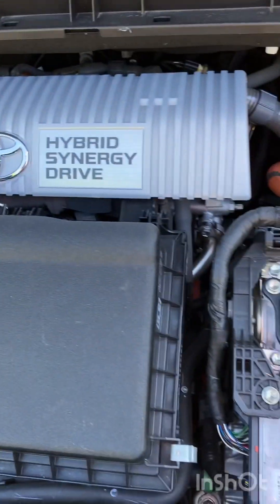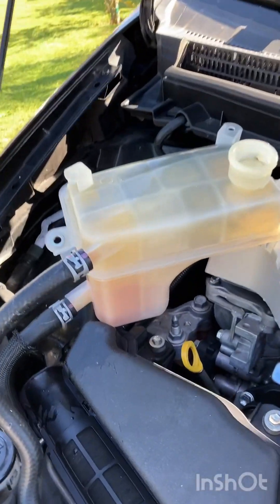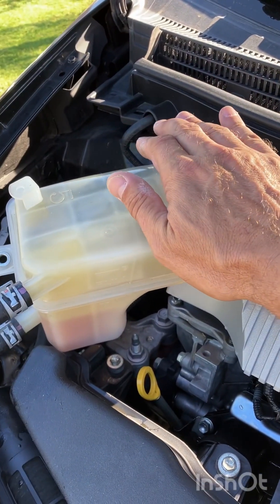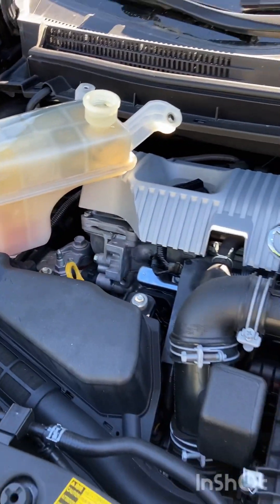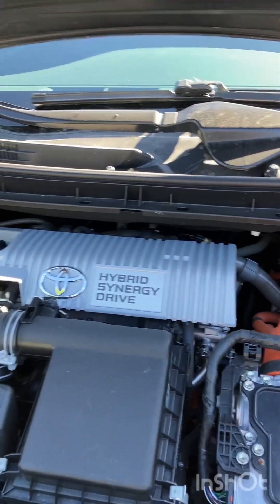To reiterate: on a Gen 3 Prius, you can open the petcock if you have some room underneath — like I did — without pulling the paneling out. Close it back up, clean it up, get some radiator cleaner in there. There are some vapors coming out, interesting. Anyway, I'm going to run this about 20 more minutes — the system's been burped and I'm making sure I have enough radiator fluid.